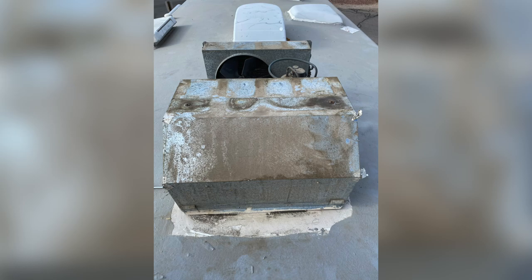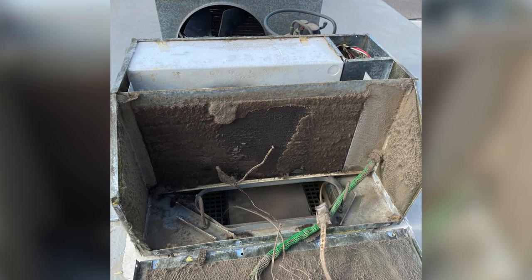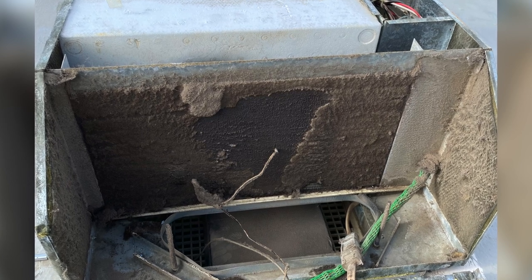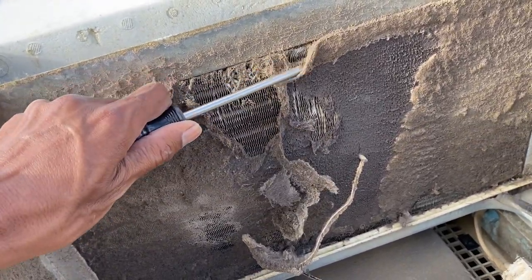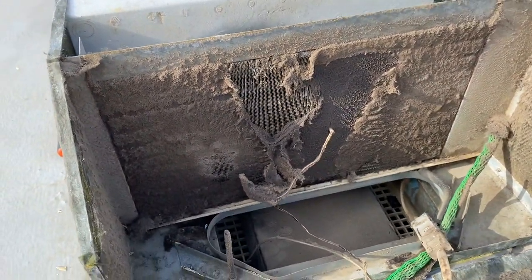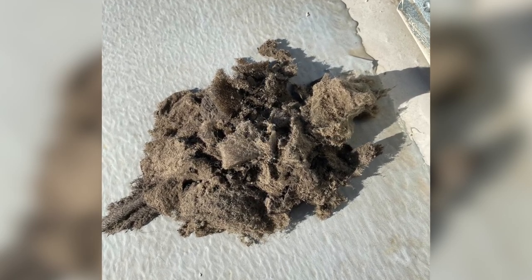This back cover also had regular Phillips screws — about 12 screws around the whole edge. As soon as I removed the cover, you could see exactly what the issue was: the evaporator was completely caked in dust. This is supposed to be clean and free so air can breathe through it, but the dust was blocking airflow entirely through the fins. I used a screwdriver to peel back the top layer of dust, and you can see just how thick and nasty it was — who knows when someone last cleaned this unit. In just a few minutes of scraping, I pulled off a whole pile of dust.